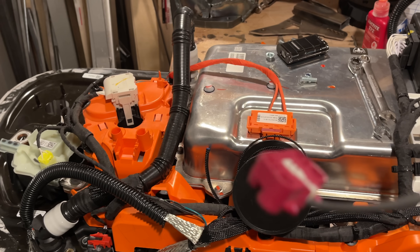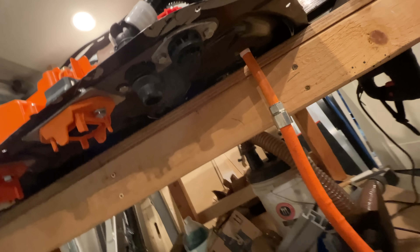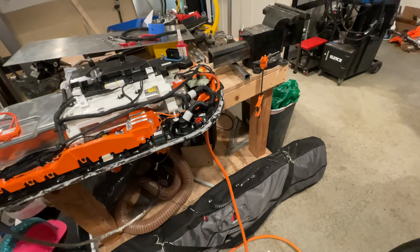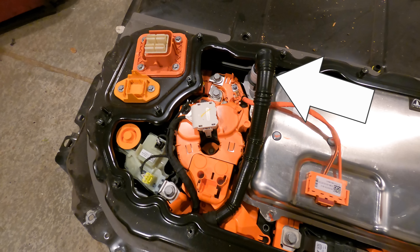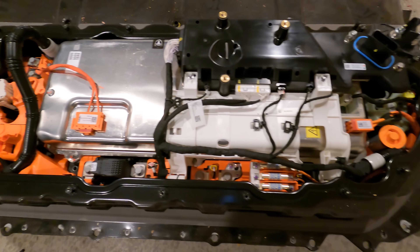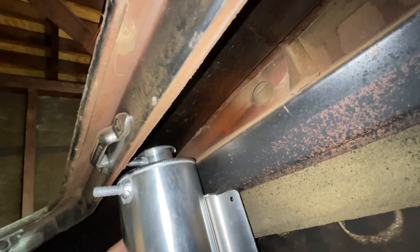The bottom has all of these cables coming out of it, and I would have had to offset it from the back of the seat to clear all that stuff, and then it's just sort of jutting out into the trunk. Also, I don't know that I'm going to use the trunk for anything — I'm not going on any road trips, and I will also have a frunk. This mounting would have also put the coolant hose going to the battery electronics really high, meaning I'd need a bleeder to get air out, or somehow fit a coolant reservoir above the penthouse up in the trunk where it would be impossible to fill. So I decided to just set it on the floor of the trunk.